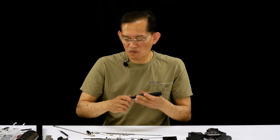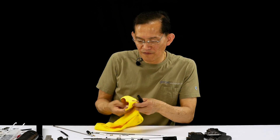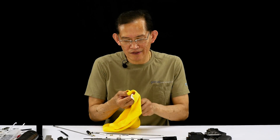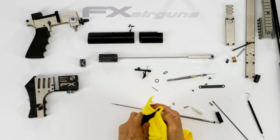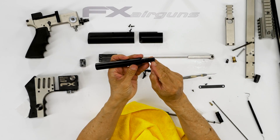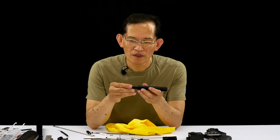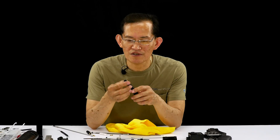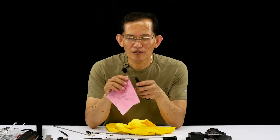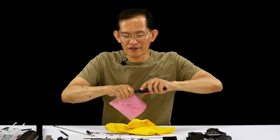This part didn't get clean, so stick a finger in there — stick a fingernail in there and shove the rag inside the o-ring groove. Now inspect and make sure the lip has no cuts, no burrs. If it is sharp, that's a problem. Usually I wrap cloth around here and put it inside the o-ring groove, using my fingernail to shove it in there.